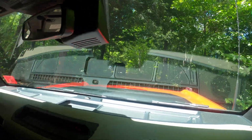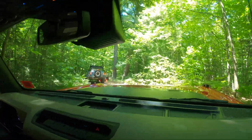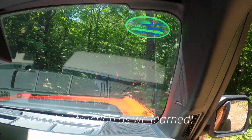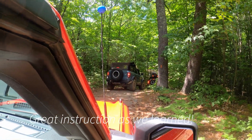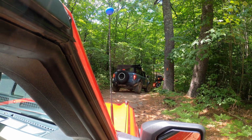Go ahead and we're going to enter our next trail section here. It is going to be steep and a little bit rough, so we're going to leave our vehicle in mud and ruts mode. We're going to shift our transmission into neutral and push that 4 low button to engage the low range in the transfer case. But for now, it's going to keep most of the other settings we had set for mud and ruts mode.